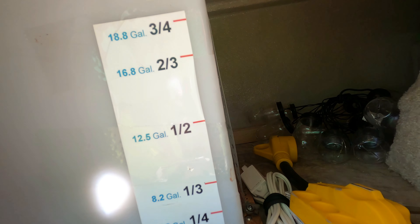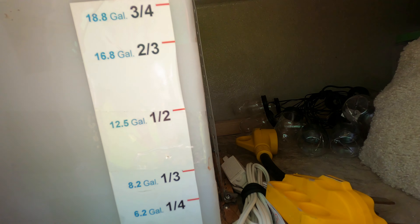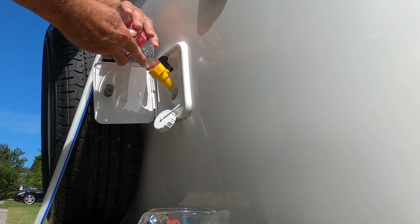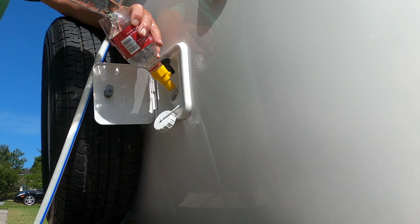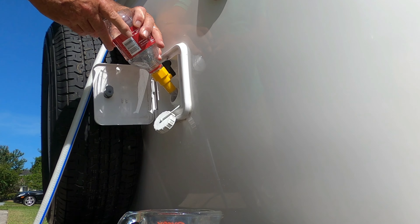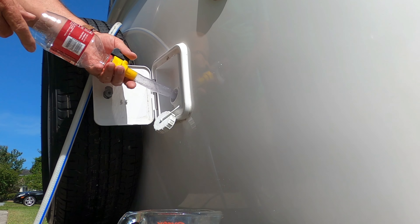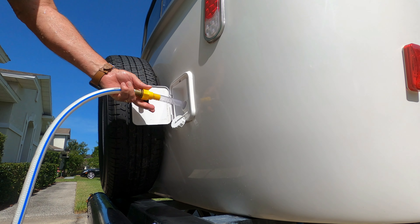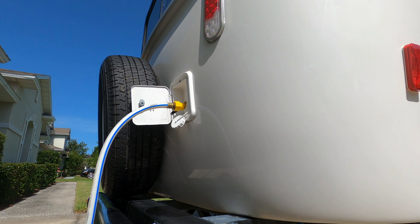I filled it a little over a quarter — about a third of a tank — but that's fine. We'll go ahead and put our bleach in now. I made a little rig to get the bleach in there: I used the same filler I used to fill the tank, took a drink bottle, cut the bottom out, cleaned it real good, and used that to pour the bleach down in. It's at such a straight angle you're not going to get it in there without some kind of funnel. Now we're going to fill the tank up all the way with fresh water.